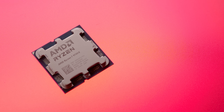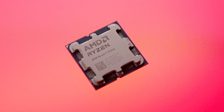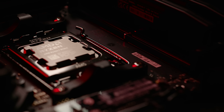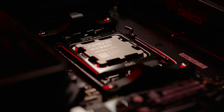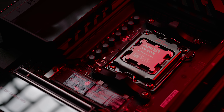A lot of my customers run 128 GB of memory for business applications, so I also checked 4-DIMM population. In 4-DIMM mode I had no problem running 4400 MHz memory — above the 3600 MHz AMD suggests is possible, though not by a great deal. The 4400 MHz didn't make that much difference compared to 5200 MHz either. Overall, memory speed wasn't holding back the performance of this CPU, which is great news for those who already have lower-speed memory kits and are just looking to upgrade the CPU.